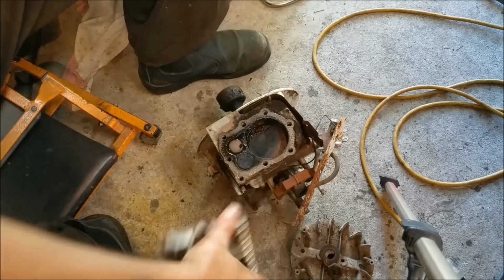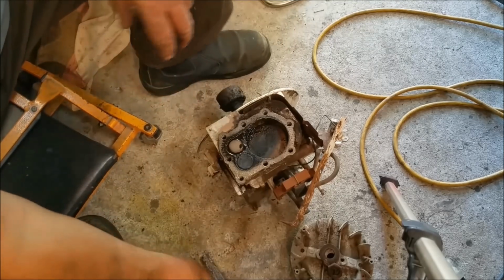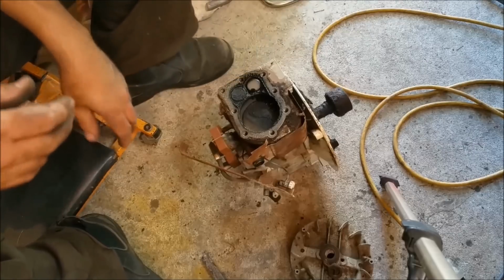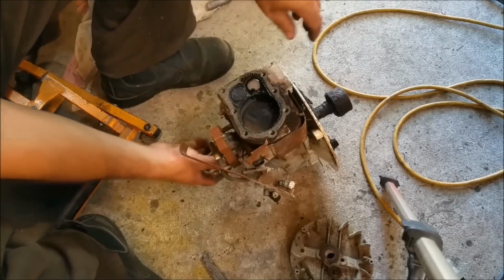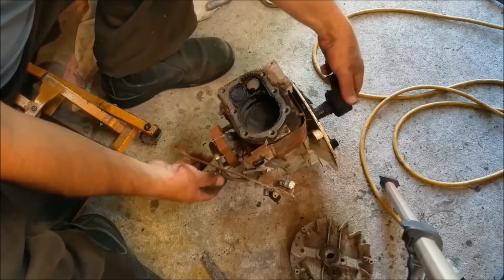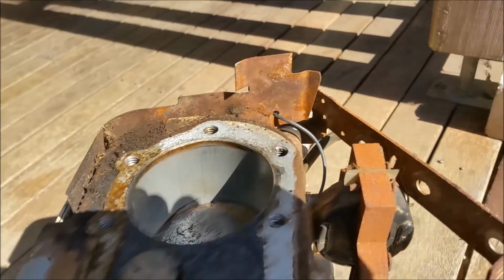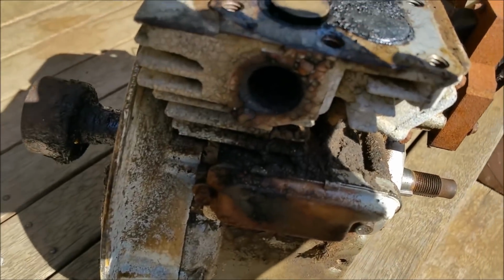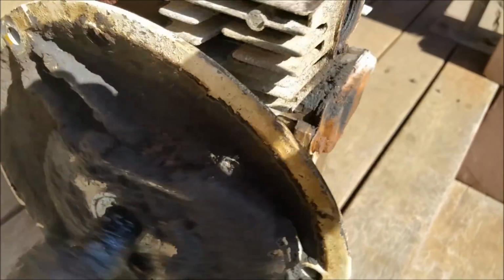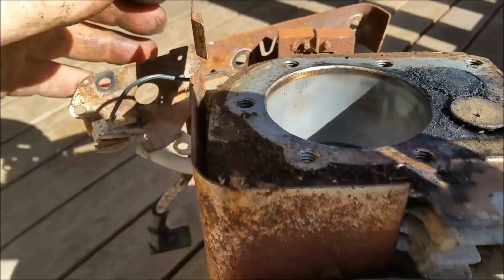A buck buys us an engine. Alright, let's have a bit of a look, hey? And we can tell an awful lot. I might get this into the light, I'll give it a good wipe. So far, I'm loving what I'm seeing though. Okay, just a minute. Bore in our $1 Briggs. There's a little scratch there, but I can't even feel it. Moving around, I've got a few marks up there. Can't even feel the ridge either.